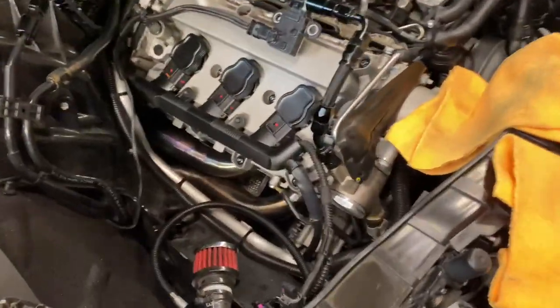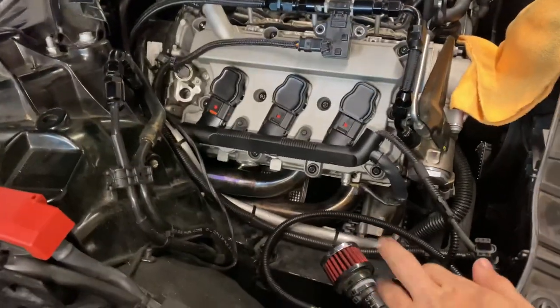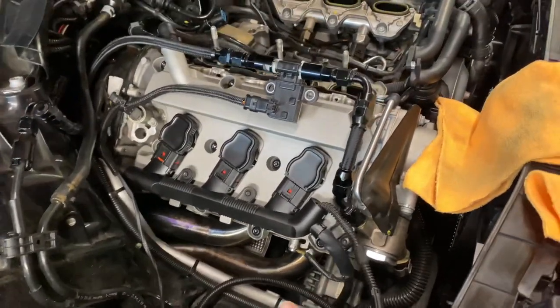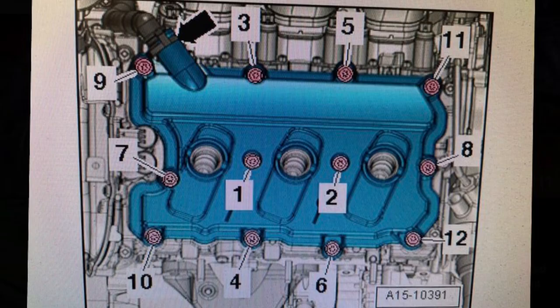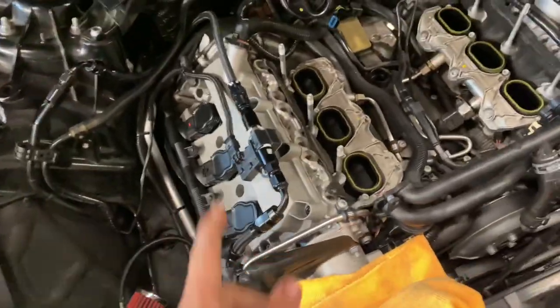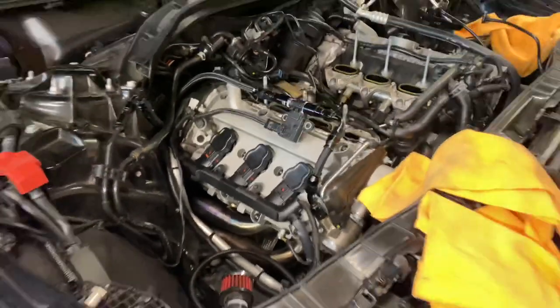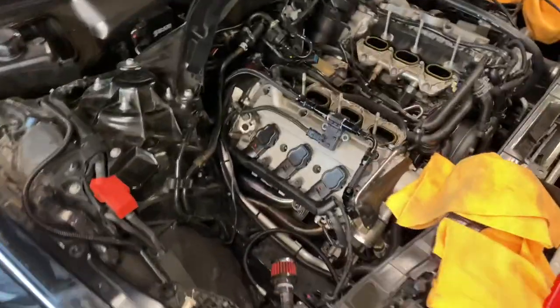I'll update you fellas in a few days. I'm probably going to be done working on this thing for the weekend, just got some parts to paint. Just giving you a little update — I've got the coil packs back in and the coil pack bracket that I painted is back on. This side of the valve cover is torqued back down in sequence. I'm going to pop the torque sequence of this valve cover in this video somewhere. Marshall Rhodes, I think the fellow that owns Vast, he sent me the torque sequence — big shout out to him. Make sure we're doing everything right.